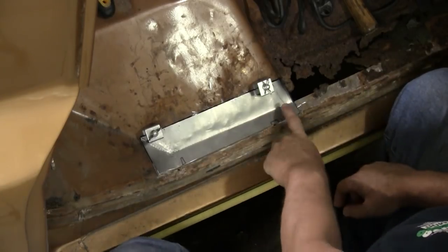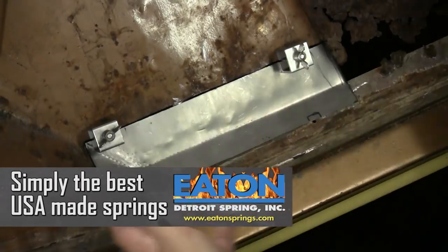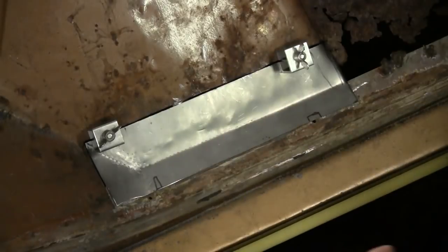This week I wanted to talk to you about making a patch panel to go along with our floor pans that are going to be going in our F100. On these trucks, a lot of times the sill area right here is going to get damaged because of just the water intrusion problem in the rest of the floor pan. Rather than trying to do a whole floor pan — the 67-72s at the point we shot this did not have a whole pan available — I'm going to do patches, and that's what I'm going to talk about today on this episode of Auto Resto Mod.